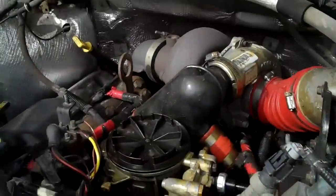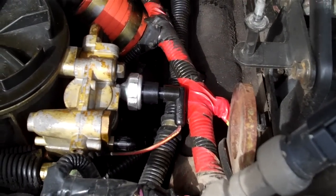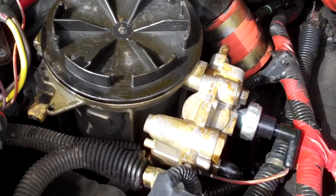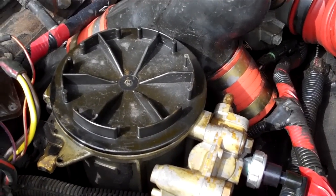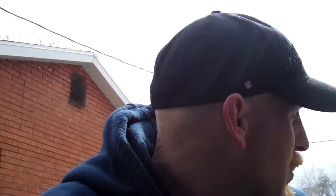Nasty looking little bee. You know they sting you even after they're dead? Don't ask me how I know that, but I know it's true. That's a common leak on these, so that's something to address. Another common one is the filter housing — having the O-ring not be replaced with the filter, or not torqued down properly, and having that leak. That's a good place to look, a common place to have a leak, a good place to start.